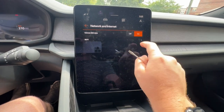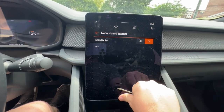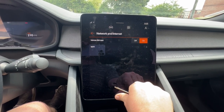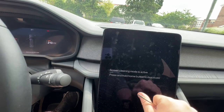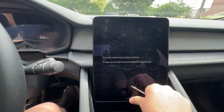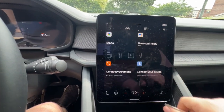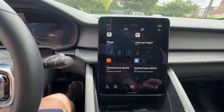My Wi-Fi does work. I've tried toggling SIM data off, restarting the car by holding this button for 20 seconds until the screen goes completely black — all the above. Nothing's worked yet. So we're going to try to go nuclear and reset the telecommunications module.